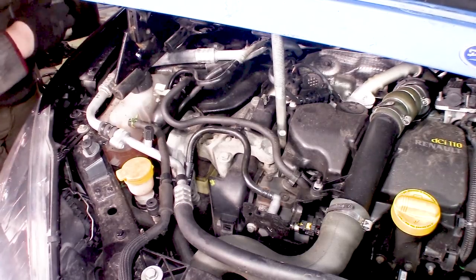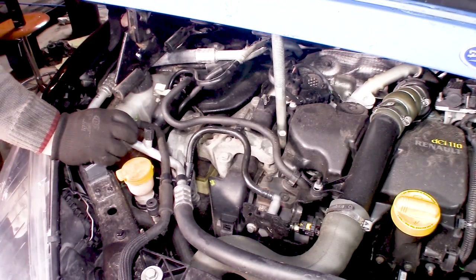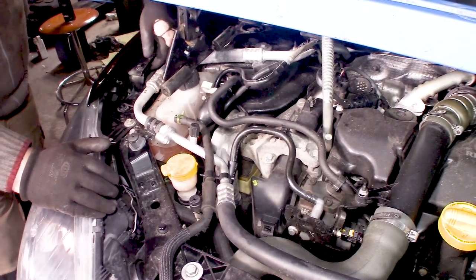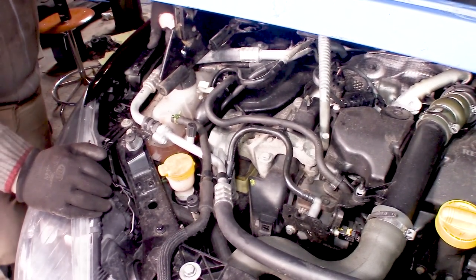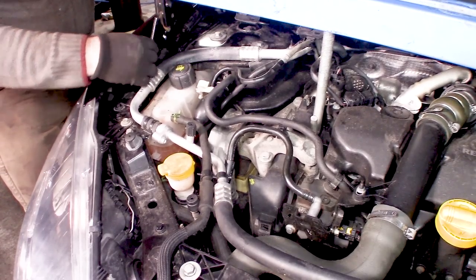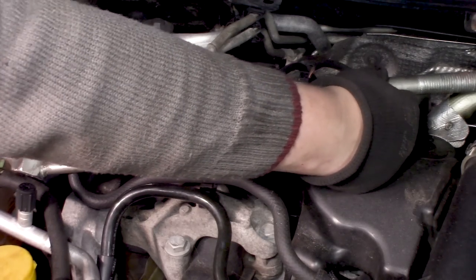It's always a bit of a hassle with new cars where you can put this brace. Sometimes fenders are not even metal anymore, but plastic. And this one has, I don't know if you can see it, a lot of room between it. So if we put it on here, we're definitely going to misform this whole panel. So I think I'm going to put it just underneath here. Right here is a lifting point. So it will be nice if we can use that to, well, lift, of course.